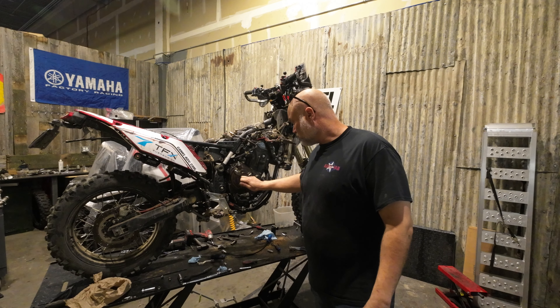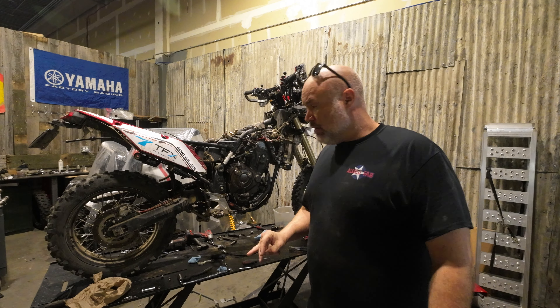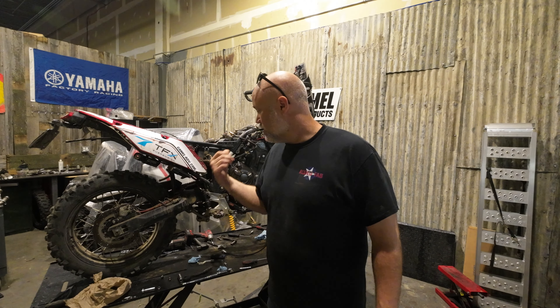There's no clutch in here. This motor only had about 2,000 miles on it when I bought it, and after we had done Five Miles of Hell I thought I better take the clutch plates out, measure them, and swap — because the ones out of this are brand new. Pulled all that stuff out and everything is still in spec. So all of the hard miles I've put on this bike over the last three years, the clutch plates are still in spec.